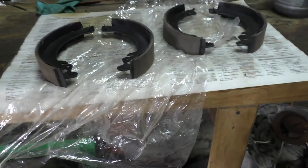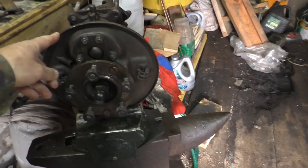Let's see what we can get done today to reach the finish line and get out driving. One thing we surely have to do is get these brake shoes onto the portal hub and anchor plate. Hopefully I'll manage to do that relatively fast. Of course I have to clean out the old drums with some gasoline and brake cleaner, but it's always good to start with the brakes with clean hands.